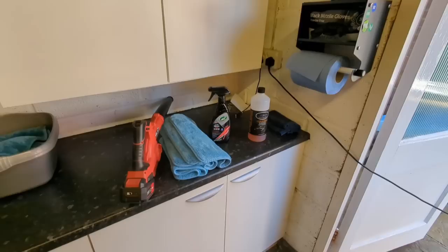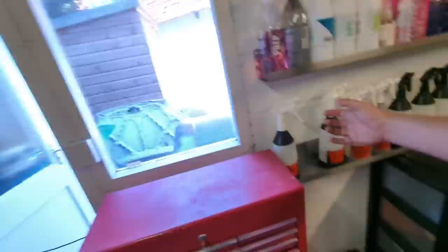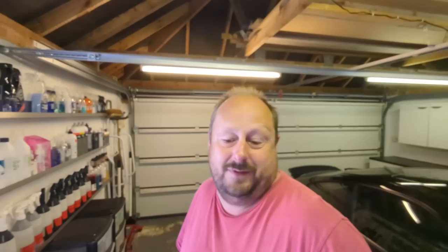Thanks for watching — you should definitely check this product out. It's really good and it will save you money, or at least be a good option. As well as using it as a pre-wash, mix some down at about 10% PIR — that's 100ml to 900ml water in a sprayer. At 10% PIR you can spritz some onto dirtier wheels, or onto heavy bugs at the front and let them soak before snow foaming the whole car. You can also mix another bottle at 1% PIR — 10ml of product to 990ml of water — as a general purpose interior cleaner: spraying the dashboard, removing greasy hand stains, that kind of thing at very low concentration.